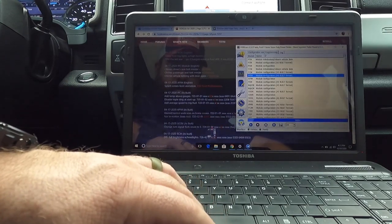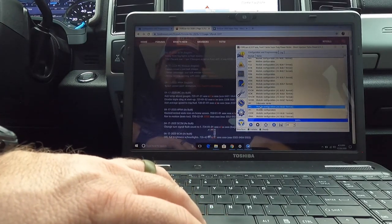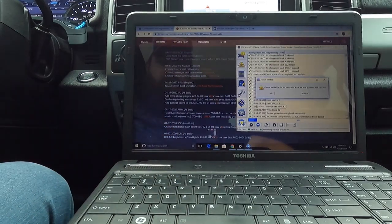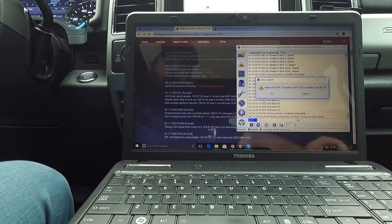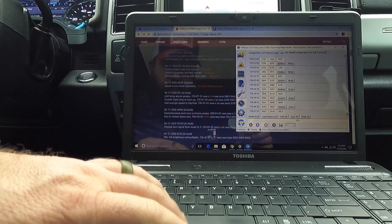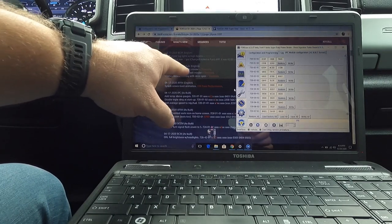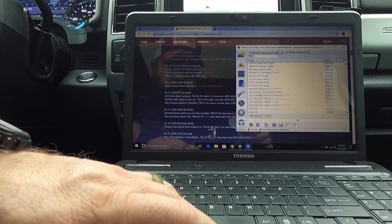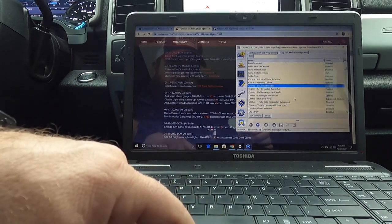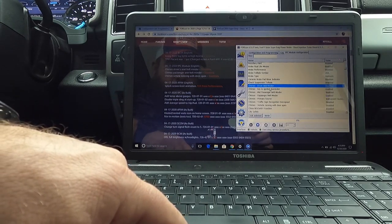All right, so we're going to stop. Go back to configuration. And this is the IPC. So the IPC as built. Run. Okay. Back to MS. Okay. And then we are going to find driver's door, or chimes, driver seat belt minder. We're going to disable that. And then we'll try to find, edit, driver's side seat belt. Key and ignition reminder.